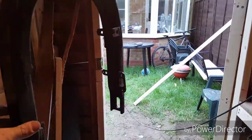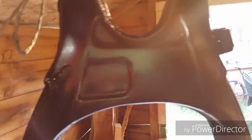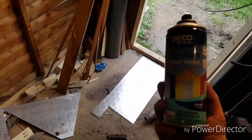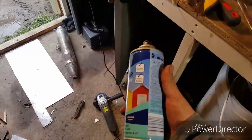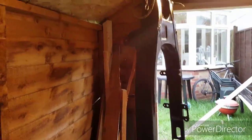The rear swing arm is actually dry now. I think I've done an all right job from what I had — it was pretty beat up. I got this spray paint from The Range — it's a UK brand. I sanded it all down, then used a detail sander with the small pads to really get into the grooves, gave it a good clean and wipe down before spraying. It says it's a glassy non-scratch finish, cost me like a fiver. You can get better stuff from Halfords or similar, but for a rear swing arm it's fine — I could always buy another one eventually.